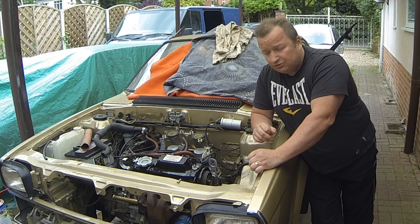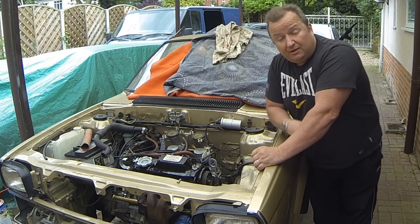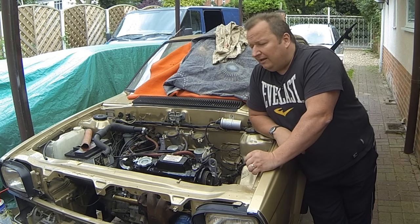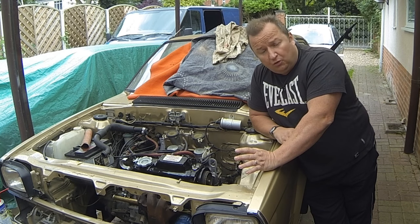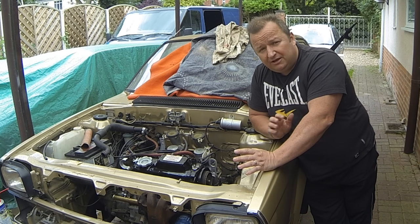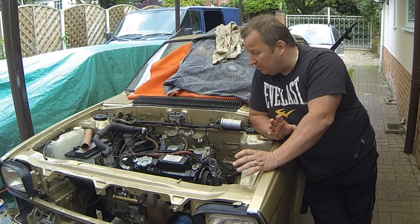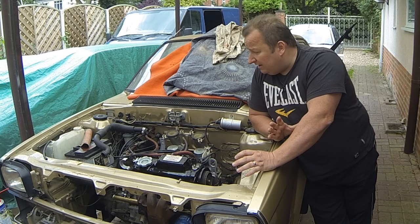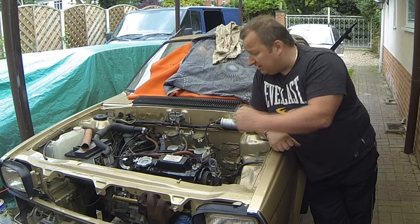Well, one of my subscribers made a comment that I was going to put a fuel filter in here, and he told me that there was actually one under the back rear wheel on this side. And so I went to the back wheel, took the back wheel off, and sure enough, there was a filter, and no fuel was getting through the old filter. So over the years, it's obviously gone hard inside and no fuel's passing through it. Lucky enough, I had a spare fuel filter, which I've put on, and then turned the engine over. So we've got fresh fuel now up to the carburetor, so that's connected up now.